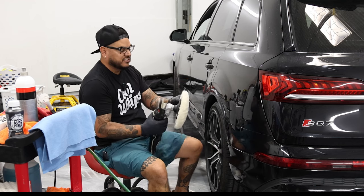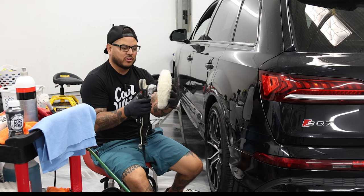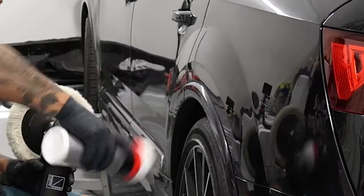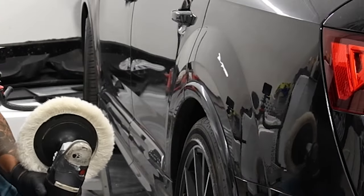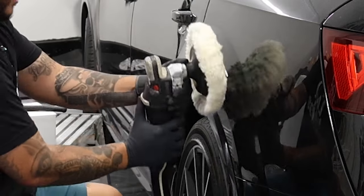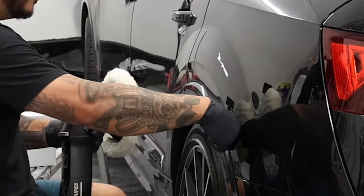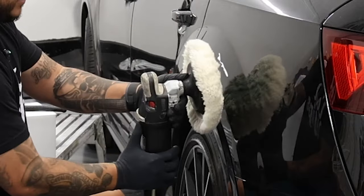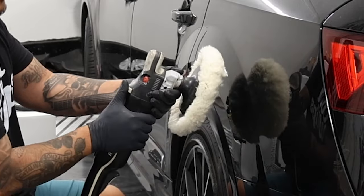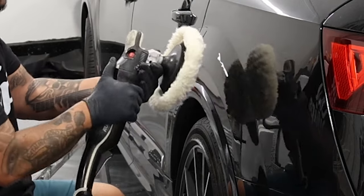You see how, versus switching out and getting a different tool — you don't need to do that. Learn this tool. If you have these different body lines, add a little bit more compound on there. You want to learn how to keep your tool flat at different angles. Like if you're going to do this area, keep it flat. You got these flat angles — flat here, flat here, tilt with the direction of the pad. If you tilt the opposite direction, it's going to be pulling you. You want to tilt with it and glide with the actual pad.